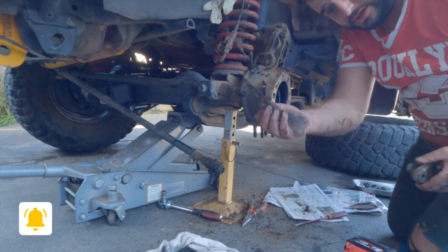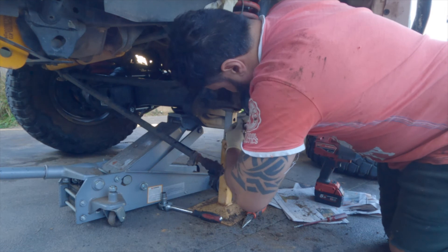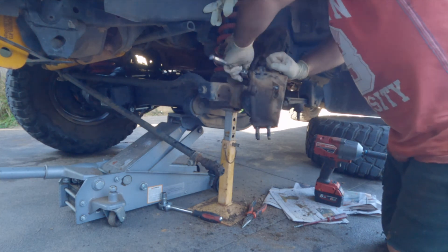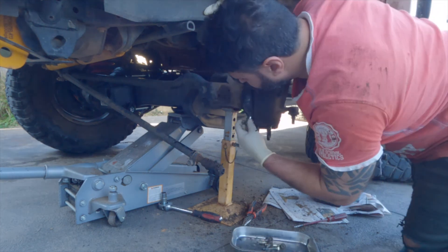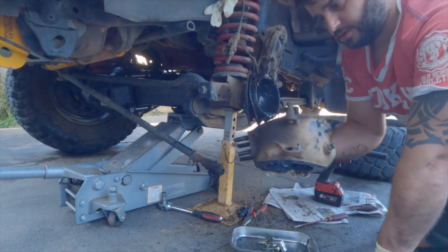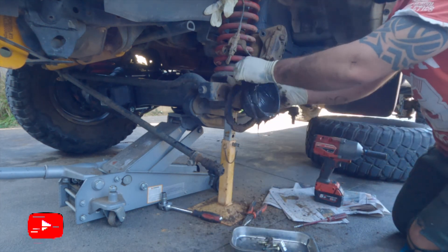As I said earlier, make sure you don't lose that. So now we're just taking off where the felt's going — it's all caked in grease, as you'd expect. It's just a 10mm. Looks like it's easy to use a 3/8 or 10mm — a ratchet spanner even works wonders. There's the bearing that dropped out. There's the hub — got the front of the hub anyway. It's just one of the bearings that go into the swivel hub.